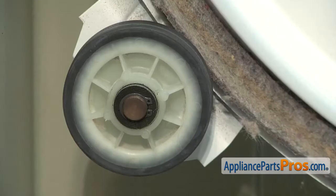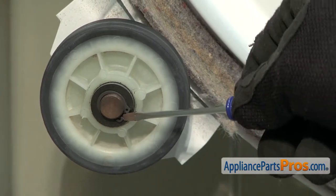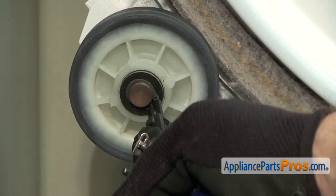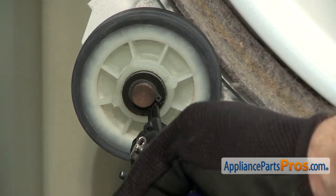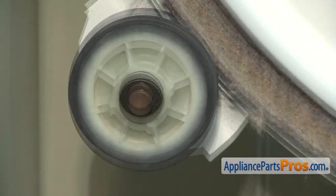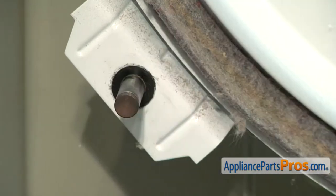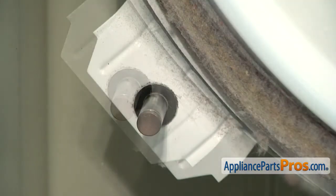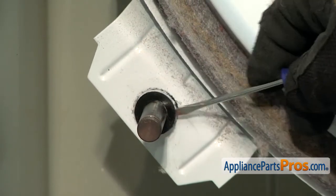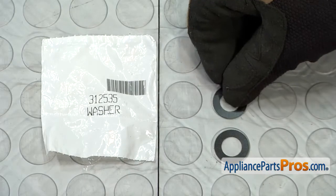In order to get the roller off, we're going to use snap ring pliers to remove the snap ring. If you don't have snap ring pliers, you can use a small flat head screwdriver and kind of get in there and pop it out of its channel. When you put this on there, make sure you only stretch it out far enough to get it off that axle. You don't want to bend it out of shape. Now that you have it off, we can pull the wheel off. And there's the first washer. The second fiber washer is back against the piece of white metal that holds the axle. All you have to do is pop it off with a small screwdriver and then you can pull it out.